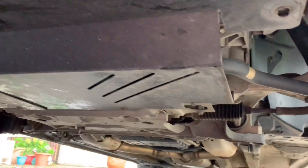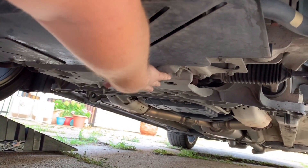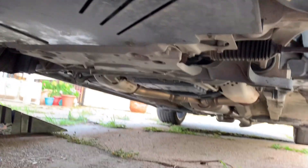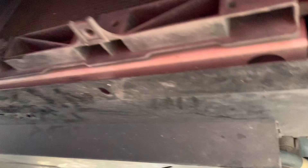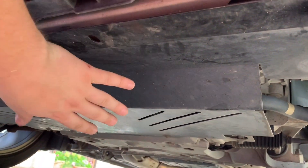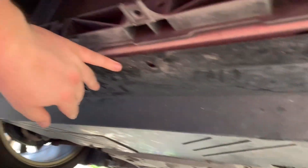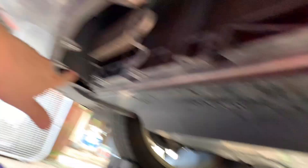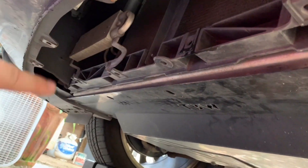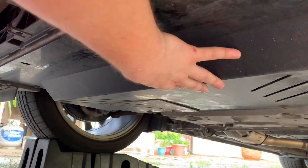The starter is located underneath this component, and I'm not entirely sure you can remove it. But the first step is removing the under shield. If you have the plastic one, you'll remove all of it, and even if you have a metal one like I do, you still have to remove all of it. It's 10 millimeter bolts all the way around.